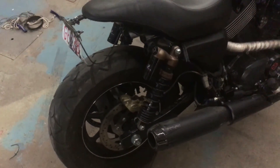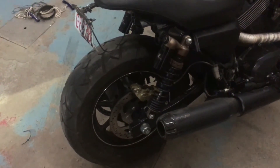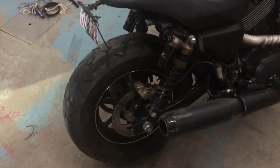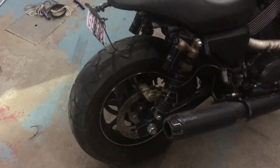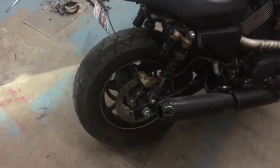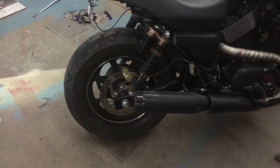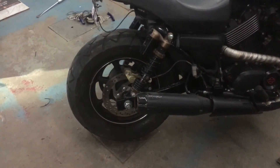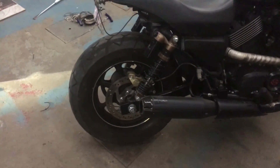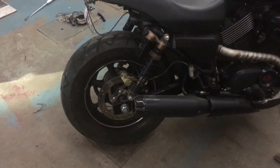For Street 500 and Street 750 owners, tire sizes are limited with the 15-inch rim, but a 170/80 R15 will fit no problem. You've got about an inch — maybe three-quarters of an inch — of clearance at the front of the swingarm. That tire does fit and I just took it out for a spin. One thing to mention: if you step up in tire size your speedometer will be off. If you have a programmer like TTS Master Tune or the Race Tuner, you can easily change that setting in the ECM so your speedo reads correctly. Make sure you adjust your speedometers accordingly. Anyway guys, have a great one and thanks for watching.